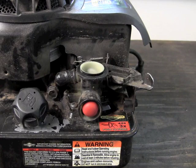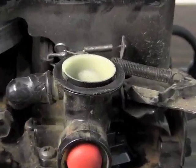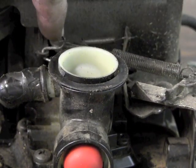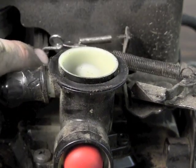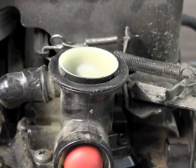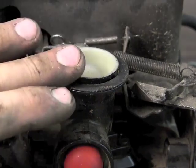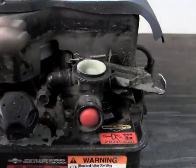Now what we're looking at here, we have some linkage. I'll zoom in on this linkage just to show you guys. We have a spring right here — this is our governor spring — and that governor spring attaches to this little coily linkage, and that coily linkage goes over to this little wind vane. That wind vane blows with the wind off the flywheel when the motor is going and it acts as a governor to keep the speed very consistent. When we take the carburetor and the tank off, that spring and that linkage and everything will stay as one unit.